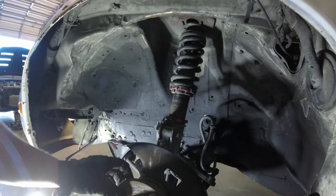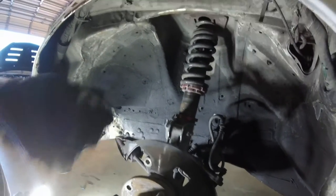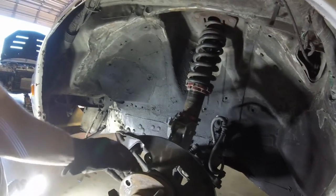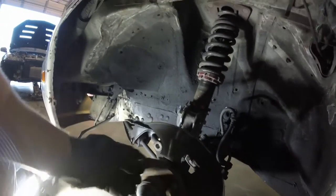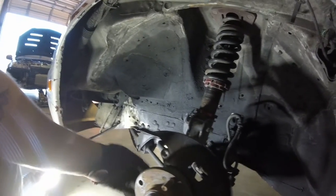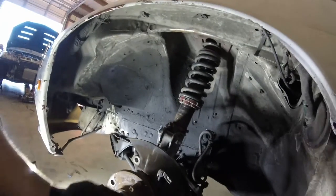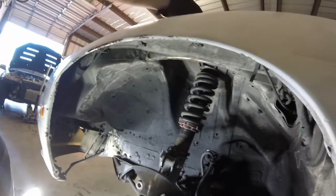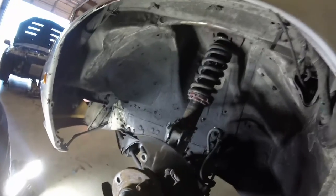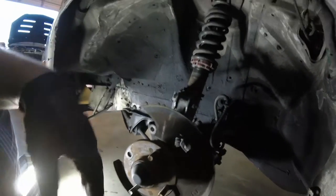Yeah, see, this is what I was talking about. This is a rear stud that somebody put in the front. The front's got a bigger hub, bigger hole, takes a bigger stud. But not a problem now because this whole thing's going away. Just got to pop this cap off, break out the bolt there, the nut there, and swap the hub. It's that simple, guys. And I think I have to trim this, so I can't remember.